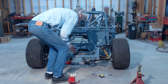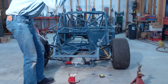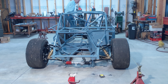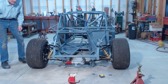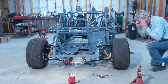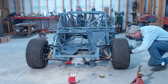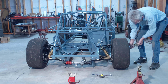I'm taking the shim out. I'm going to check my steering shaft to make sure it's centered again, and check all my strings — make sure the center string is on its line. Let's check the camber again on this wheel. Just a hair over two degrees, about the same as the other side. I'll call that good for now.